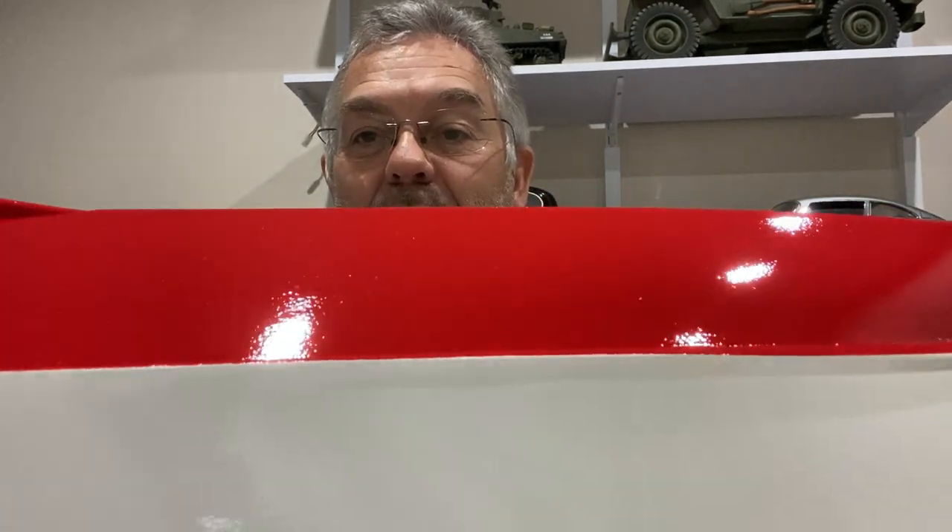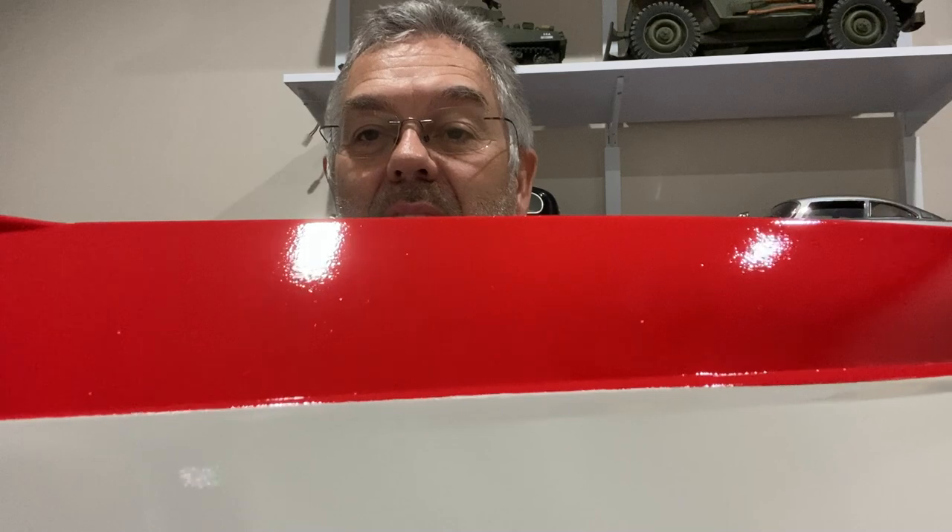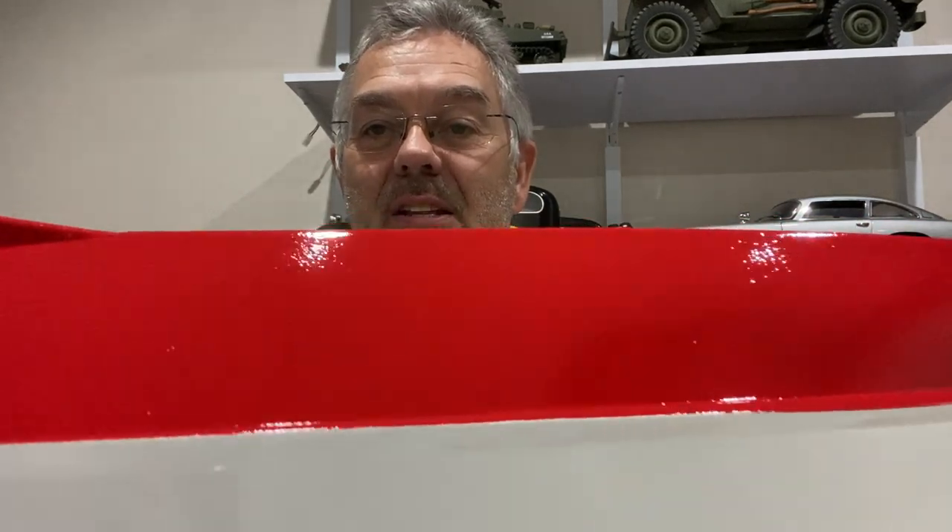I'm not really very good at painting - you can see it's got orange peel on it. So to try and improve this I'm going to wet sand it. I'm going to start with 1200 grit sandpaper, go through 2000, 4000, 6000, 8000 and 10,000, and see if I can get that to look a bit smoother.